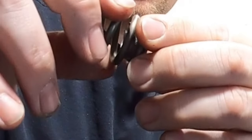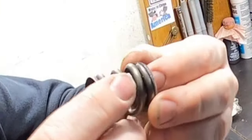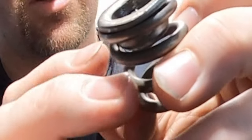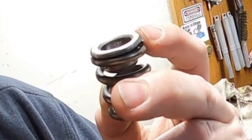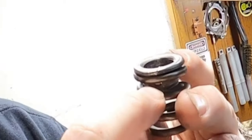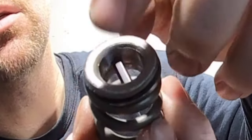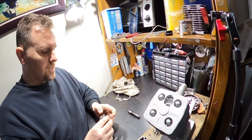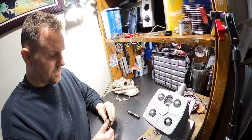And when you line it up, because this doesn't spin in the pocket, okay? What you want is you want the pin, which if you look, see where the pin is? So the pin is straight with you guys right now. See how the spring's flat? That's the way they bend it. And then it starts bending down into the spring shape. Well, right before that bend happens, it's where you want the pin to be. And then directly across, so let me spin it so you can see. So this is the other side, pin directly down. It's right in the flat spot and right where the other spring starts to bend up above that. So you have a lot of chunk of metal of the spring holding it on both sides, keeping it plumb and square. So that's, I find, to be the very best spot you can put it. So there you go.